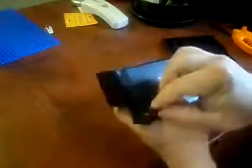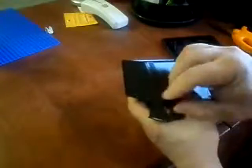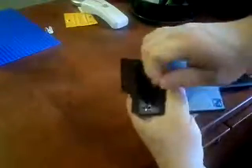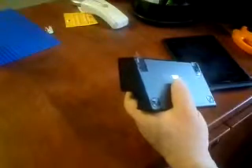The small rubber feet kind of tricked me at first. I took them off and thought there's no screw under here. But when I got the big rubber feet screws off, I realized I just wasn't going to get this thing apart — I even tore a rubber foot. I poked around a little more and found that under the small rubber feet there's a plastic panel that's glued on that has to come off.